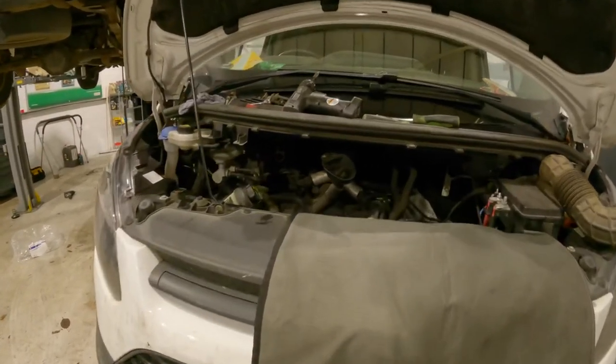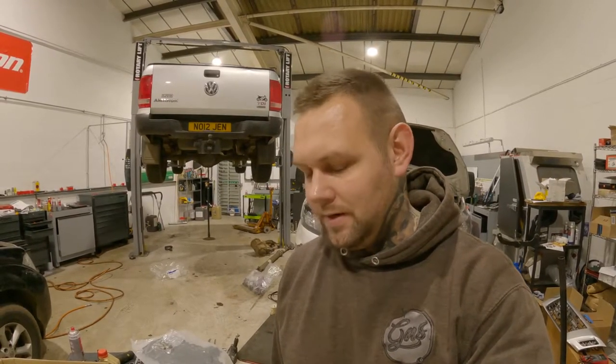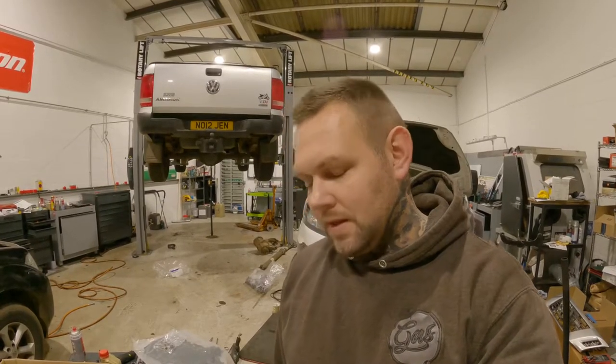So that's the fix for the Ford Transit. It's not a how-to video — the van came in for what the customer thought were just brake pads, but the brake pedal was rock hard with no brake assist, no servo. We stripped the vacuum pump down, found it was broken, and upon inspection found little bits of rubber around the vacuum pump. That can only have come off the rubber timing belt. It's maybe not the best design, but if the vehicle is maintained well and using the right oil it shouldn't in theory have an issue.